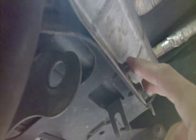And the way to install this natural vacuum leak detector is to unscrew these two screws right here. Use either a 10mm socket or a 10mm wrench. Take them off, and this shield should come off. And then to remove the pump, it has a little tab right here. Push down, and then twist to your left, and this pump should come out.